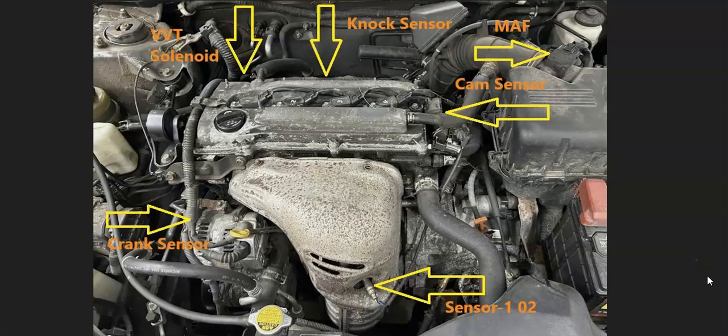One thing to mention is that the manifold absolute pressure sensor — depending on the year of the Toyota 2.4 liter — may or may not be present. If it doesn't have one, the computer is going to use the mass airflow sensor and other sensors to do the calculations it needs. If you do think you have one, it's usually located on the intake manifold. But if you get an error code for a bad manifold absolute pressure sensor, it's a good idea to find a manual for that year of Toyota to know for sure what's going on.